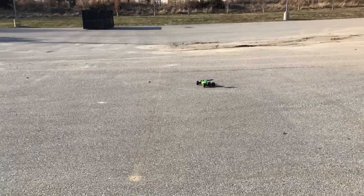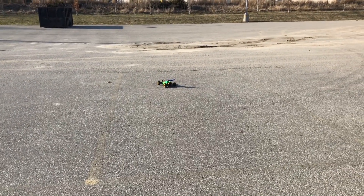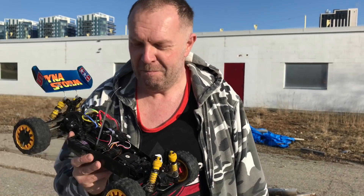That is absolutely awesome. I'm just going to run the full battery down - I won't bore you to death, I just want to make sure. I was a little pessimistic because I really didn't think it was going to work. After I pressed stop on the camera it ran for about 10 minutes - motor's hot, speedo's hot - and it did not go into limp mode once. It's a cheap fix: that unit is about seven US dollars, five pounds, and it's ten minutes of work. Now we've got working speedos!